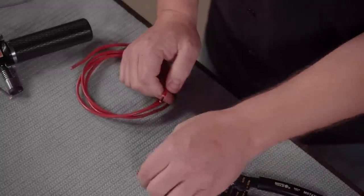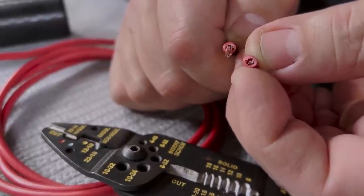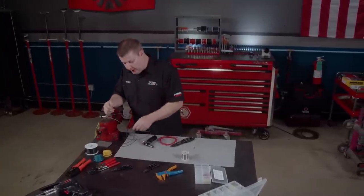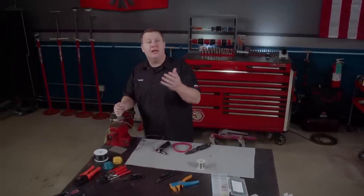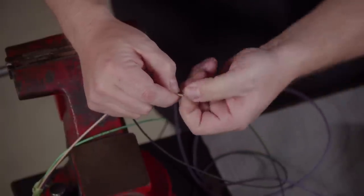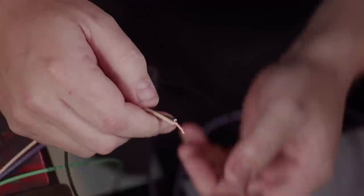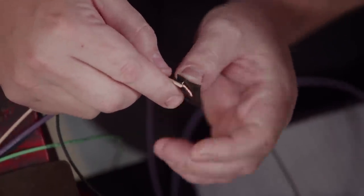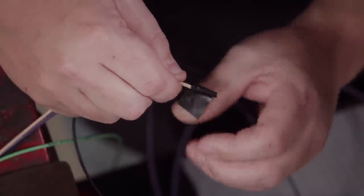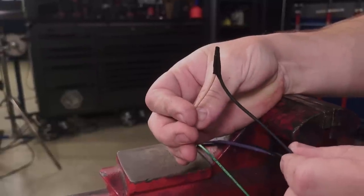Using the wrong gauge slot will cut into the wire, and that can lead to a poor connection — you can see a few pieces of copper in the sheathing, and you don't want this. The next thing: let's say you want to connect two wires. Let's start with the most basic way, and that is with a pigtail or rat tail splice. That's where you take two or more wires and simply twist them together. A connection like this works, but it has its drawbacks. It's not a very strong connection unless it's soldered. If you wrap it with electrical tape, moisture can still get in because of the gap, and it's not very pleasing to the eye. But one thing's for sure — it's easy.